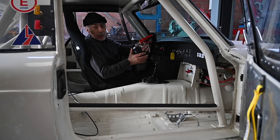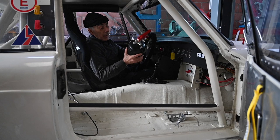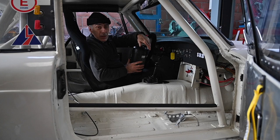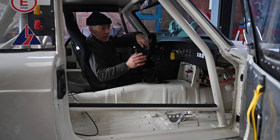I have driven with this before and often it's an economical decision, but after all I think your life is worth more than just a bottle of agent. These bottles only last a certain amount of time and they also need to have a certain volume. On this type of car, which is a small car, four kilograms is more than enough. In this video I'm going to install a fire suppression system — not based on a manual system but based on a semi-manual system using nozzles to spray around in the different areas in the cockpit.